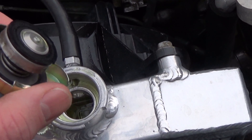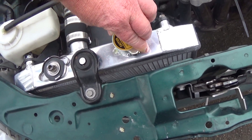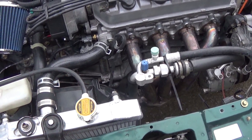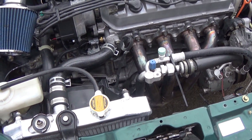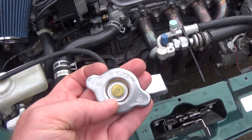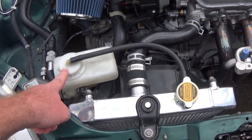These are rated at, I think, 16 psi or something like that. So when you have pressure in your coolant line or your radiator, that actually raises the boiling point — that's why they design coolant systems so they're pressurized, to keep it from boiling as quickly. When you reach your prescribed pressure — this one says 16 psi on there — it'll actually push the excess fluid into your reservoir.